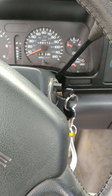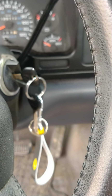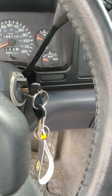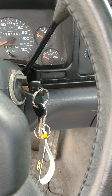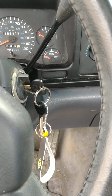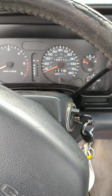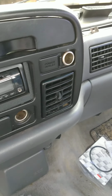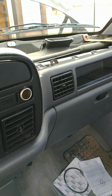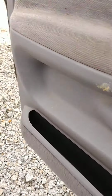Anyway, I'm going to get the speedometer right, and I'm going to get the temperature reading right, because if your temperature's not reading right, then the ECM don't know how warm your engine is. And then, you know, things like your EGR valves and your oxygen sensors and all that stuff don't work half the time. Pretty much the reason all these check engine lights are on. And this one has a bulb check engine light. Good thing they didn't back that up with a dinger-binger. We would be in bad shape with Dodges. But anyway, I'm going to go out here and drain a quart of transmission fluid out of this thing.